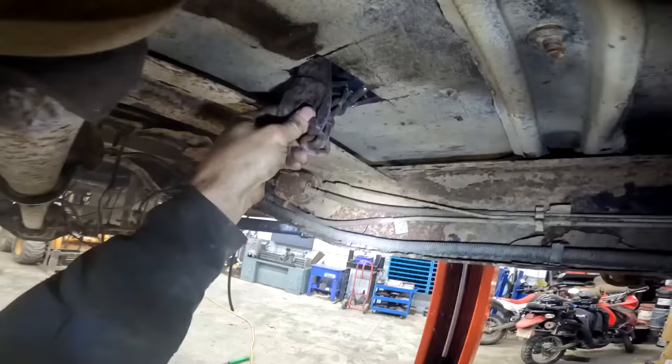Alrighty, we'll take the fuel line that you're gonna use. Cut off a little, well, you don't cut off a little bit, but I mean, we can sacrifice that much. Princess Auto step bit, and then just drill the thing on one side here. It's just plastic, get a little carried away. There you go. So that's a nice tight fit. Now another one here. That's kind of a tight fit. It's fine. That's what she said.